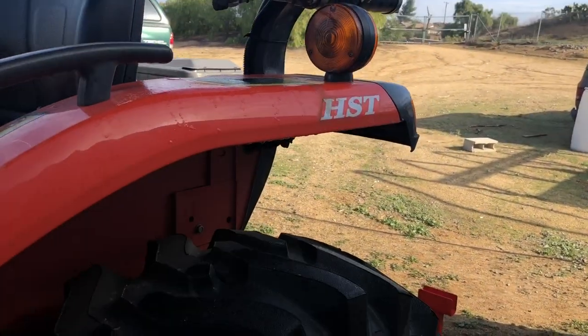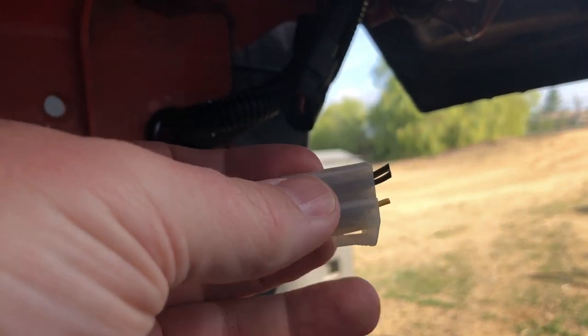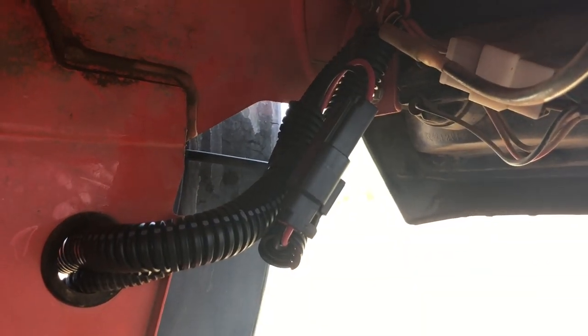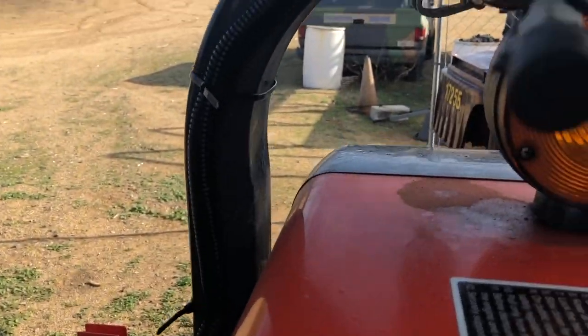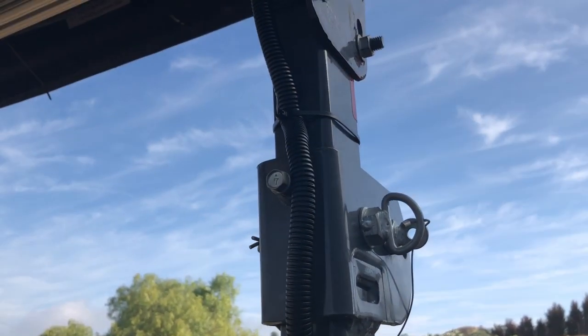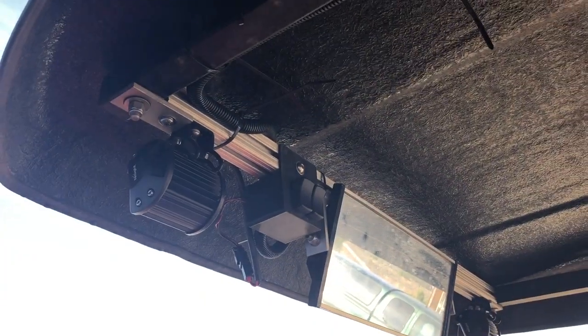There's a factory work light circuit under the left rear bumper. The connector originally looked like this, but I cut that off and put on a better connector right here. It's a 10-amp fuse circuit with the fuse in the fuse box. I just run power up the inside of the rollover bar. I don't ever fold my rollover bar so I didn't bother making enough slack here — it just goes up along this rail and over to the switch.